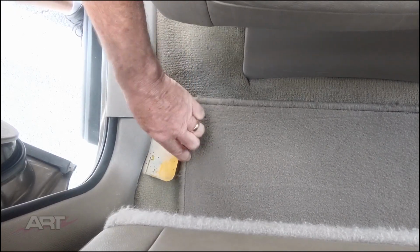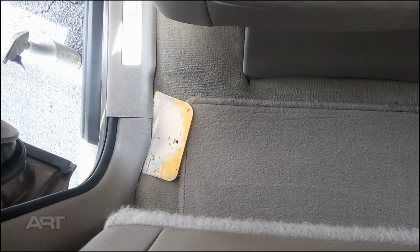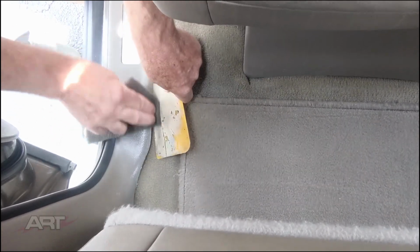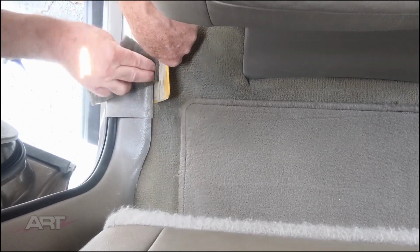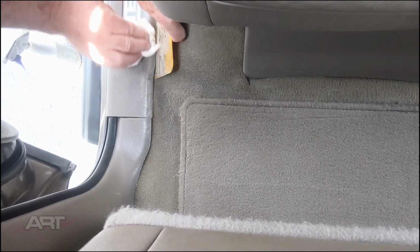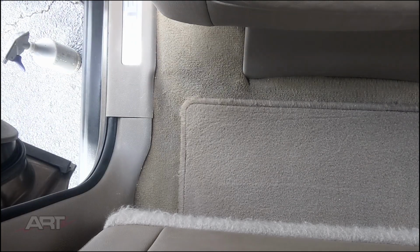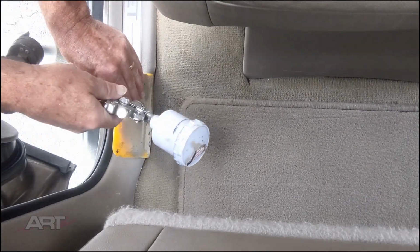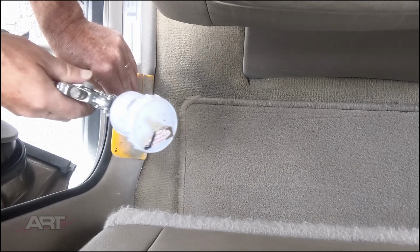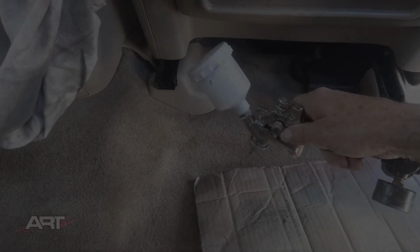So this is what I wanted to show you using the scuff pad here. Just spray some of your cleaner, water-based cleaner, on the scuff pad and just move this right along. Without the scuff pad, it's difficult to get down into the grain of the plastic when you get the overspray on there, but this makes it really slick. And that cleanup you want to get done right away, because this dye is so tenacious that you'll really have difficulty getting that off if you leave that on the plastic for any length of time whatsoever.